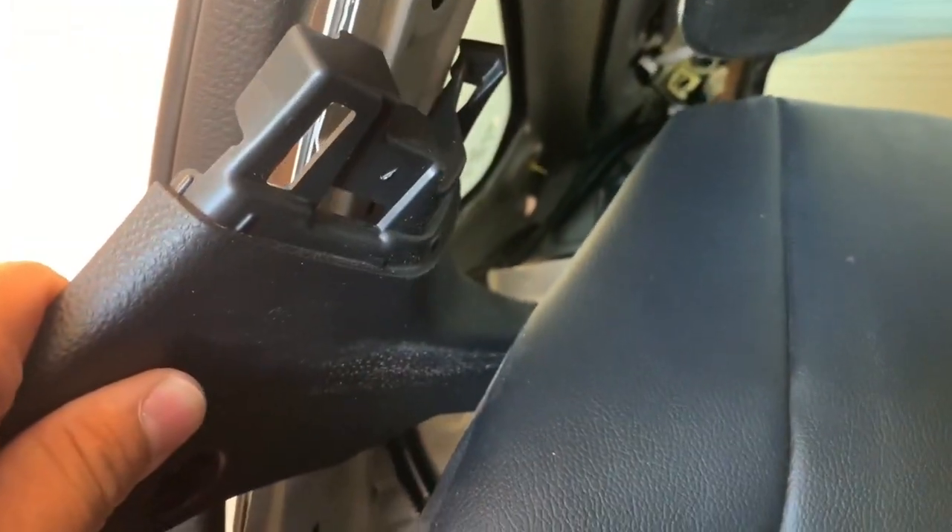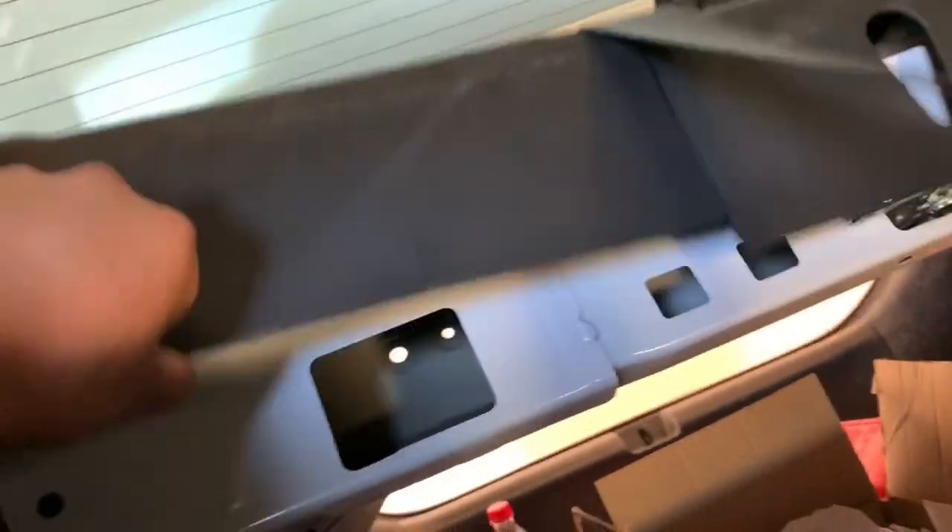I lowered both seats and pulled this back away — the seat belt panel, which also just pulls kind of away. Basically, you have to get this speaker cover up. When you do, you'll see this little silver box right here — this is the wire we need to get out. You can just reach your hand back there. To get it undone you squeeze in and it pulls out. There's only one plug on this side and it goes right there.